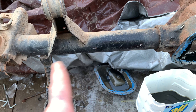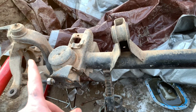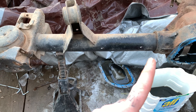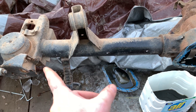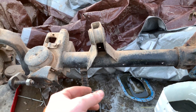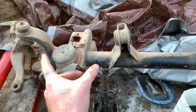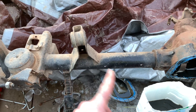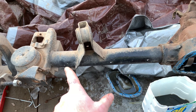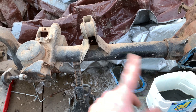We're going to drill the holes — three on this side, two on this side, and two over here. I've got to do this before I do the cut and turn. A lot of videos show you to clean out the tube first, then drill, then clean again — so we're just going to do it all in one shot. Drill the holes out, clean the tubes, cut the C's off, sleeve it so it's even, weld the C's back on, and finish pounding the sleeve in and welding it to the tube. We're going to be plug welding it — you won't even see these when I'm done because I'm just going to plug weld and grind it down flat.